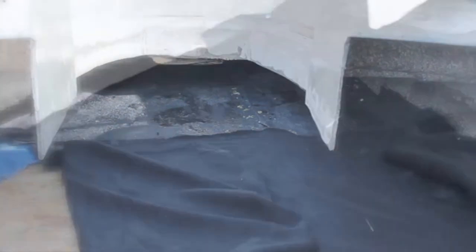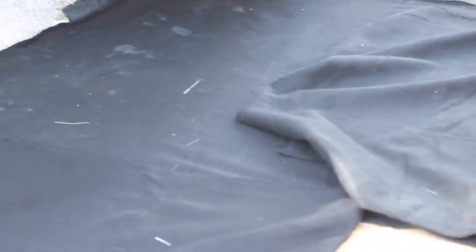I got my neighbors to help. We measured the floor, cut the stringers, got everything in there, fiberglassed the entire floor, and put new stringers in. Did a lot of ordering online — ordered some two-part expanding foam, got the foam poured in pretty nice, got the floor laid out and it actually turned out pretty nice. Got everything fiberglassed, got all the cracks filled. We had a couple of problems with the measurements on the fiberglass, but we managed and worked through it.